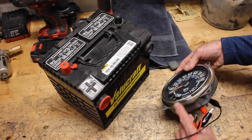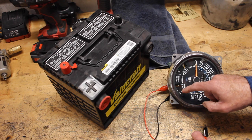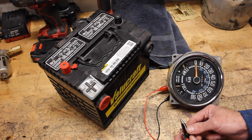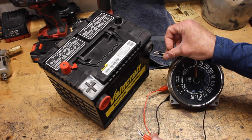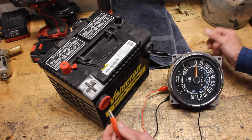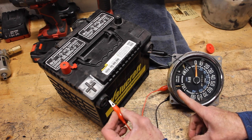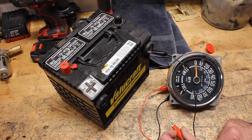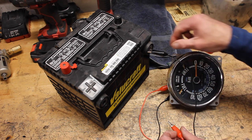Flip over the fuel gauge so we can see what's going on. What we're looking for is the indicator arm to move — it will go quick up to full. This is a good indication of whether it's able to take power. I'm going to hook it up to the negative and just touch the positive. There you go — we know the fuel gauge can take power, and it went all the way up. Super cool, super exciting.